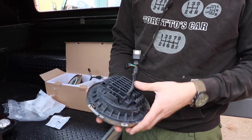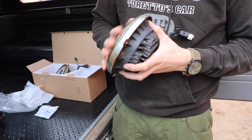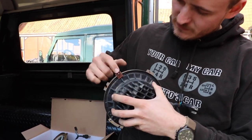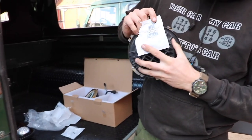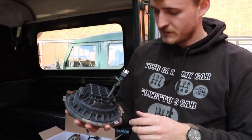When you put them on, you need to get a fastening kit. As you can see, I ordered these headlights about 3 years ago. Yeah, about 3 years. You can already see they're quite rusty, and these small tabs here are holding it in place. So you'll need to get this part number here and get two of those as kits for each side. I'll put it down in the description.